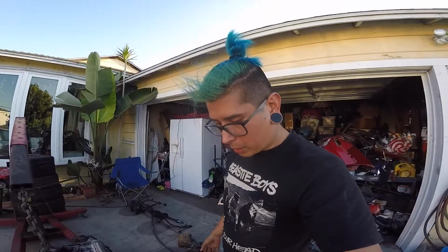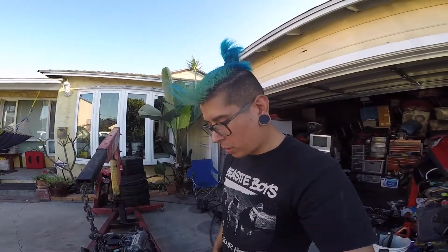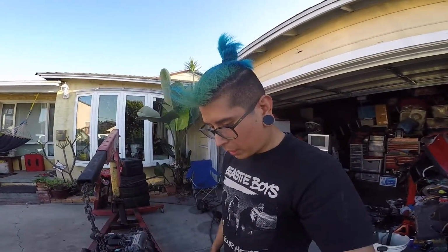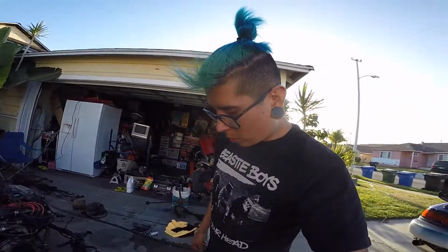But yeah, so I think that's gonna do it for this video. I'll probably just show the trans after. I'm gonna start cleaning it right now and power washing it. I'm gonna start spraying it down with the degreaser and then blocking off all the holes that I can't have water going in, and then just clean it, because I am gonna end up taking it back home in the MR2, so I don't want it all dirty in the car.